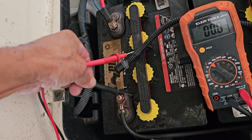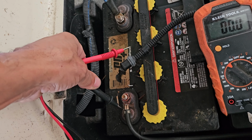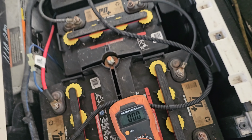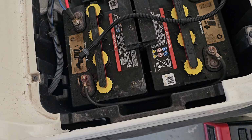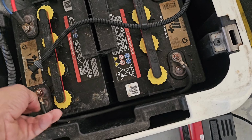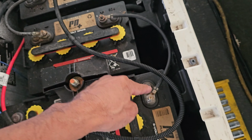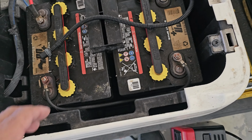So what you need to do is disconnect them. Get them out of series. These are looped together, so 8 plus 8 plus 8 plus 8 plus 8 and so on. You need to disconnect them so they're not bridged together and charge them individually.